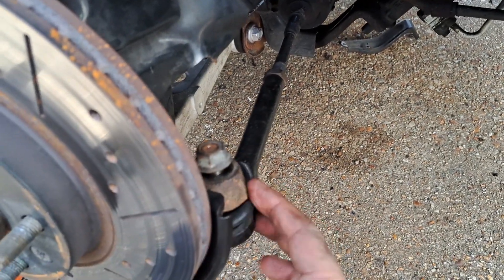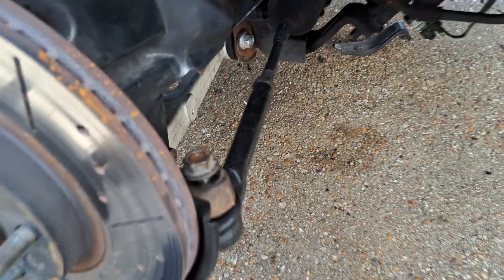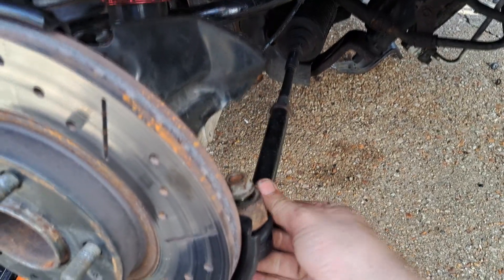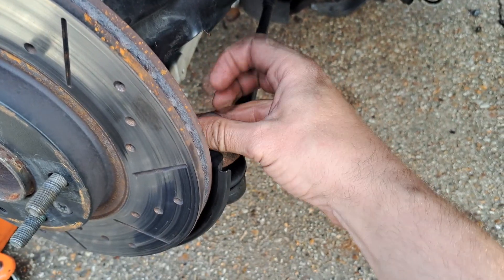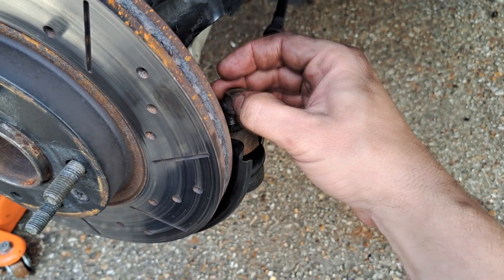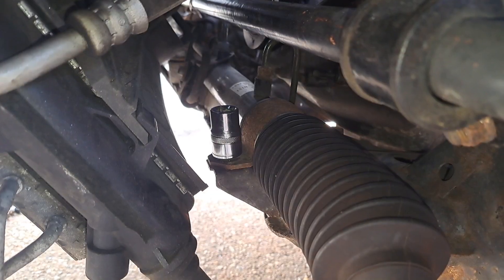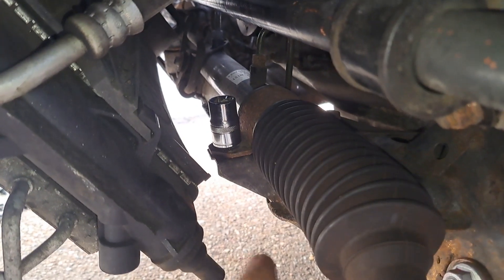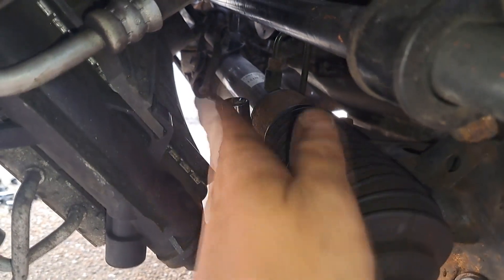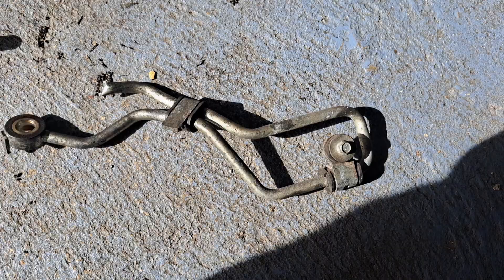One of the first things I've done is undone the ball joint at the tie rod end — leave the nut on, and then that's loose. Take your nut back off and that's one easy way to get these rod ends out. Get your nut off — that's now off. Do the same on the other side. On the passenger side the 17mm socket goes into a captive nut underneath. My next job is to take off both of those that hold the bracket that holds the rack.